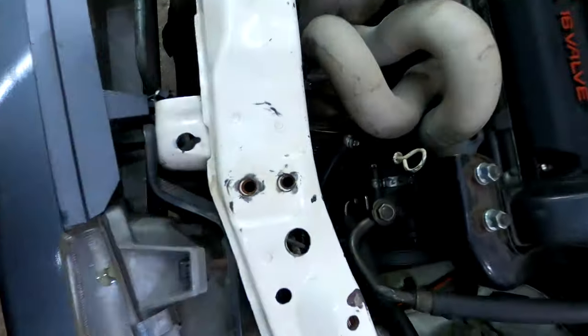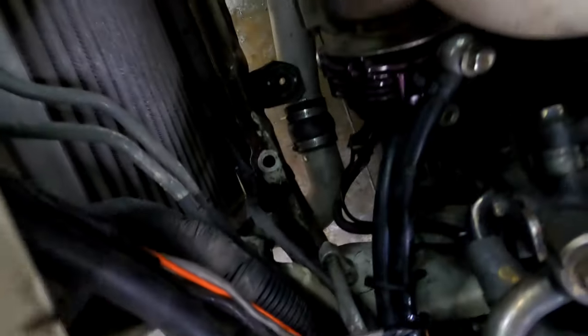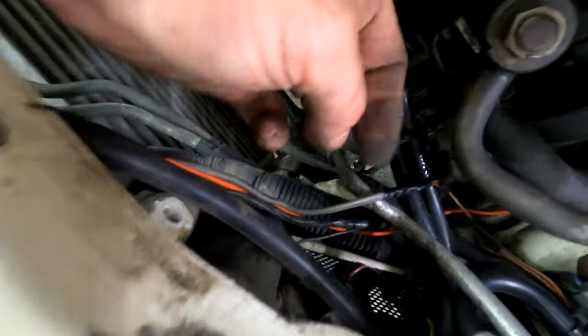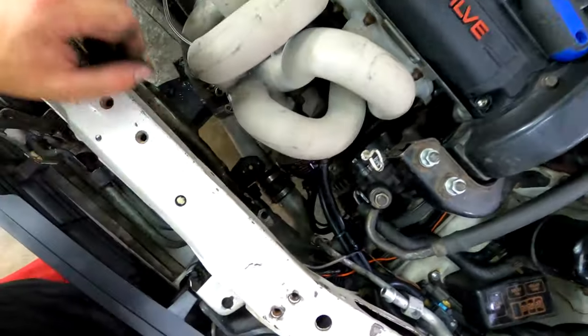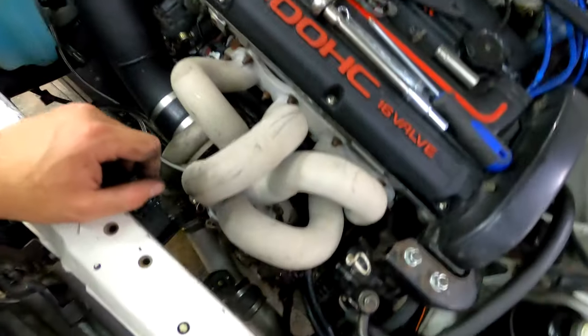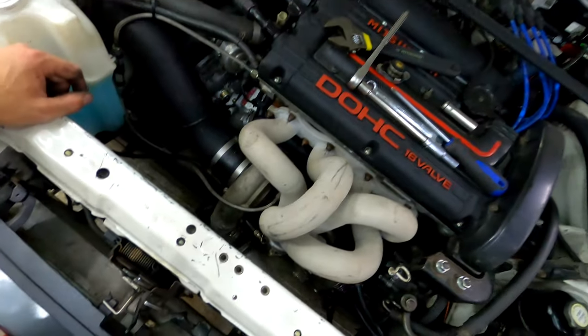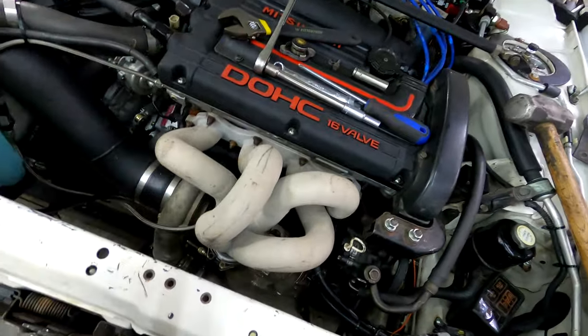Same thing, this thing just kind of wiggles out of here sideways. Fan first and then kind of sideways into place. And then I use the factory plug for the AC fan, and then the wastegate lines just kind of went, I think, under one of the pipes. But we'll get it back in, get the O-rings on, and at least pull a vacuum just to get moisture out if I'm not gonna do the compressor right away. But I'm gonna get this back together, the radiator in, coolant in, and then finish this step A and then move to step B.